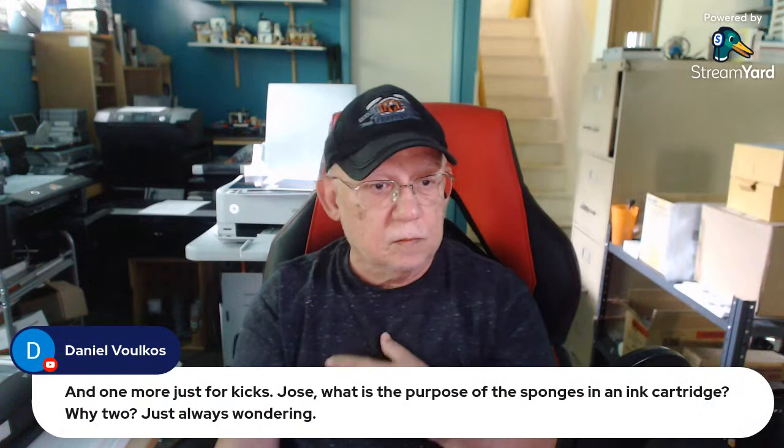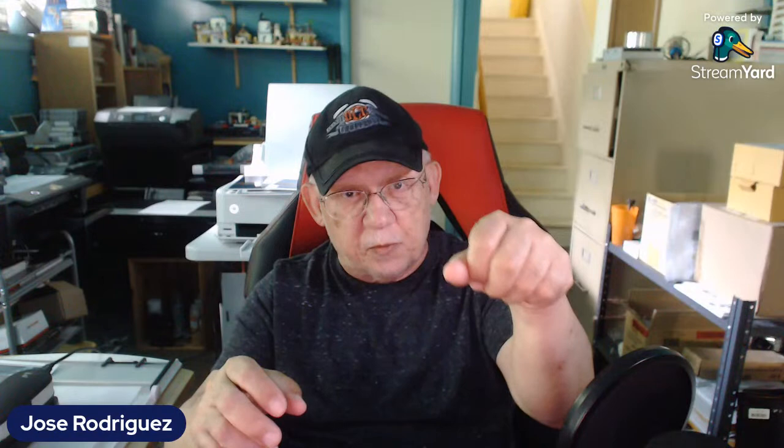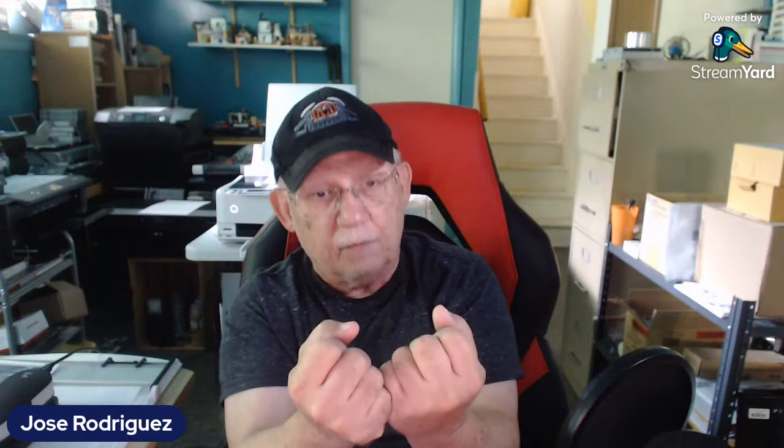What is the purpose of the sponges in an ink cartridge? It just holds ink. It's a different type of ink delivery. If you get a regular kitchen sponge or bath type sponge, and you soak it and you lift it, don't squeeze it, just lift it. Water will drip out of it. It will slow down and then stop dripping, even though the sponge is still fully saturated by water. If you squeeze it, a ton of water will come out. The sponge holds on to ink, and the printhead system applies a need for ink from that sponge. It is a control feeding type mechanism.